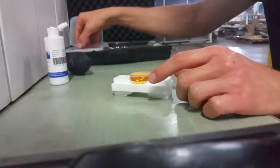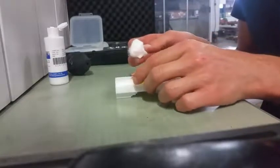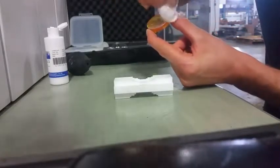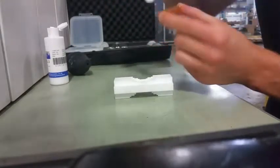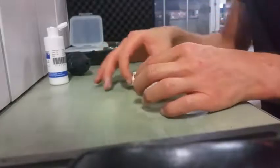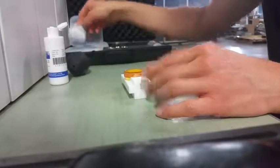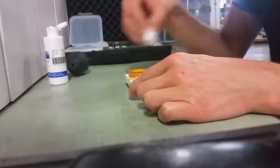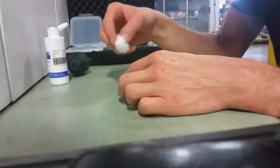Now use another cotton pad — open it, grab the lens, and with a gentle side-to-side motion, clean the dry Topol. Then place the lens back, blow the air again, open another cotton pad, and with a straight one-direction motion using a little harder pressure, swipe off whatever Topol is left on the lens.